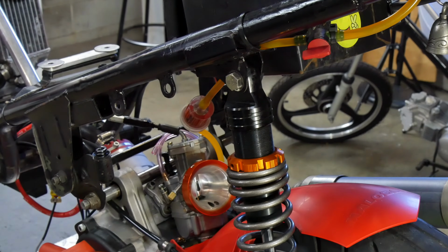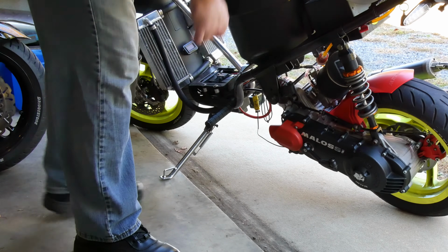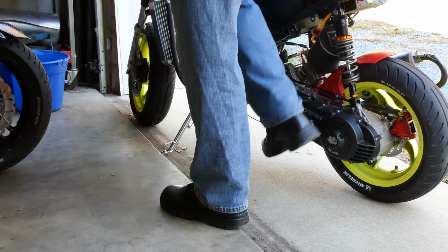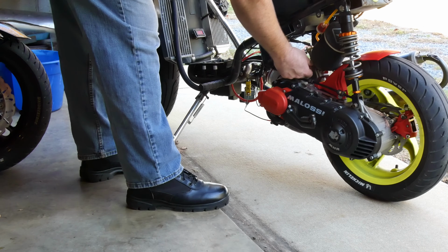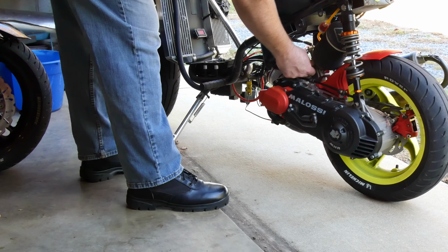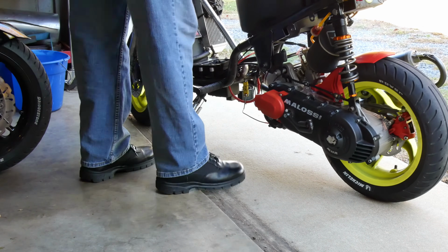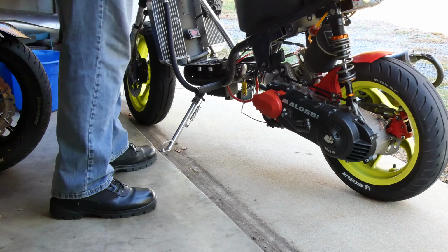I reinstalled the air filter, turned the fuel supply on, pulled the choke up, and fired it up for the first time with my new carb. That completes the installation of the carb, so I'm going to wrap this video up here.